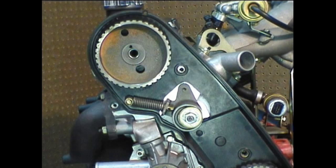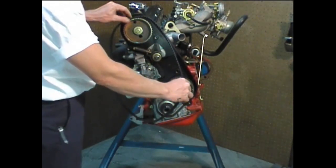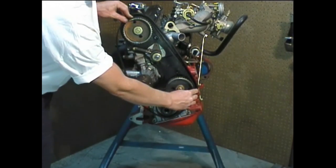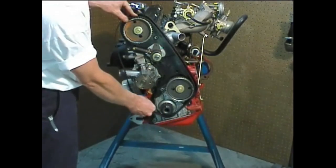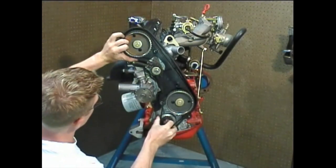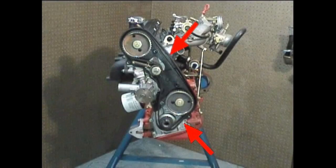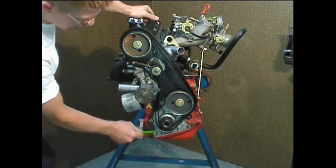A common mistake is improper seating of the timing belt tensioner, which will cause the belt to ride on the outside edge of the front portion of the gear. Be sure the tensioner is fully seated against the block before final assembly. Reinstall the back cover, the timing belt tensioner, the camshaft gear, the intermediate shaft gear, and the crankshaft gear. The new timing belt has two single marks and one double mark. The two single marks align to the camshaft and the intermediate shaft, while the double mark aligns to the crankshaft. If the marks don't seem to line up, you may have the belt backwards. Install the new timing belt starting at the camshaft, working to the intermediate shaft, the crankshaft, and finally at the tensioner. Be sure no slack exists between the camshaft and intermediate shaft, or the intermediate shaft and the crankshaft. Check your single mark on the cam, the single mark on the intermediate shaft, and the double mark on the crankshaft.